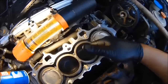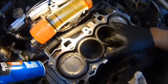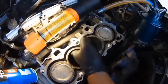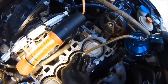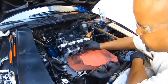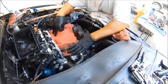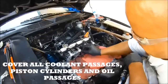Get a rag and soak all that water up — the water will create rust on the cylinder walls. Make sure you lubricate these. Grab some oil and put it on the cylinder walls, especially if you let this sit overnight. Oil these cylinder walls so you don't get rust buildup. Next, clean the intake and exhaust manifold gaskets off. Put rags here to cover the piston holes and cooling passages, then use the blade to work the old gasket material off.